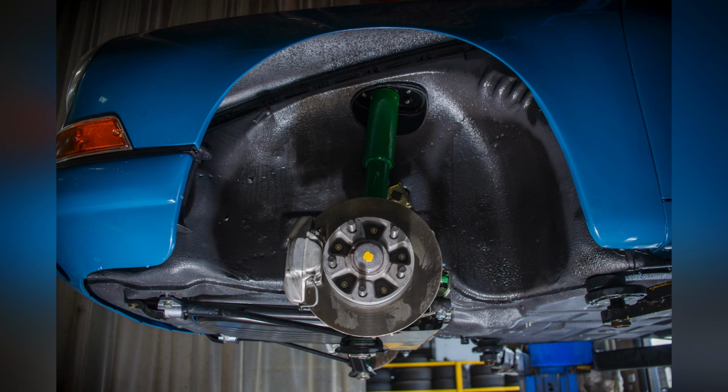Brakes. The brakes, again, we wanted to keep it lightweight and do that early look. So we did the S calipers. They're restored by P&B. All the brakes are restored by P&B. So you've got early style, '72, if you will, early S calipers. And in the rear are the stock calipers, but also restored by P&B. All the brake pads are Porterfield R4S's, which is their street autocross pad.